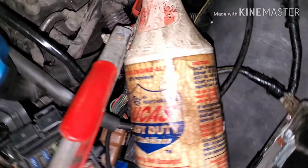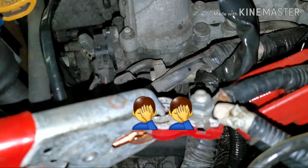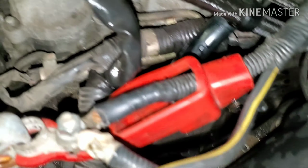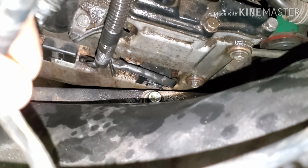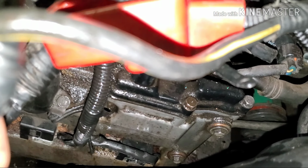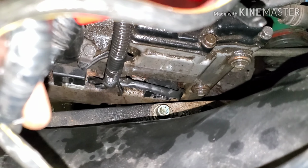So that brings us to the ordeal here. I can do both these side spark plugs, no problem. They're already in there. I can do this front side cylinder number 2 spark plug. Oh Jesus, I'm dumping fuel everywhere. All right. I can do the number 2 spark plug somewhat easily. Number 4, literally impossible. I already knew this was going to be the case, but I confirmed it yesterday. Tried to take it out, and it ain't happening. There's absolutely no room between the frame rail to wiggle the coil pack out.